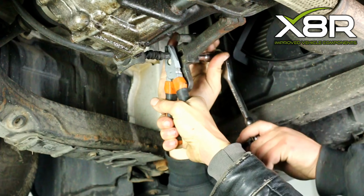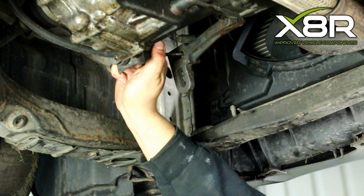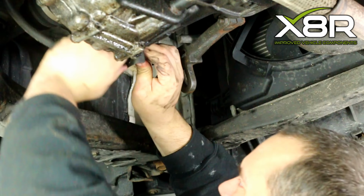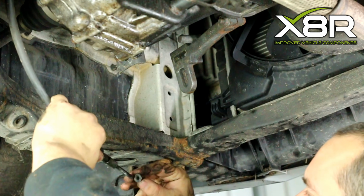The clutch cable is located under the vehicle at the base of the gearbox. Remove it from the holster using a 10mm deep socket whilst holding the other side with grips. Ensure to keep hold of the spacer, as this is essential for adjusting the clutch in future. Removing the clutch cable will release tension from the clutch pedal and make this repair much easier to carry out.